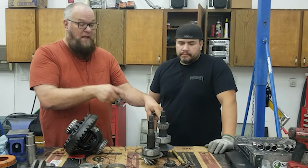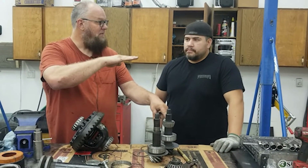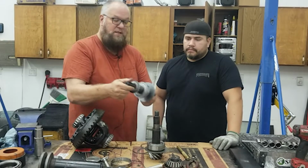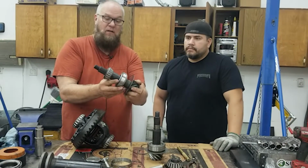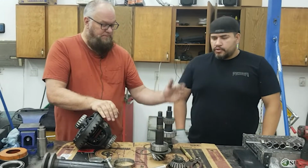And that's important in our off-road stuff because, as you know, a lot of us, we have to run shims in the front for vibrations or for just driveline angles to prevent binding. And so that puts that pinion, instead of being like that, where it usually is, it can put that pinion in an angle. So keeping this upper bearing oiled is important. So we're gonna add this into Ryan's axle. Sweet. Let's do it. And it'll be oiled and lubricated.